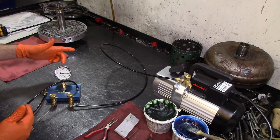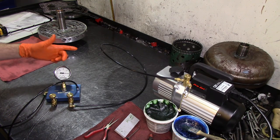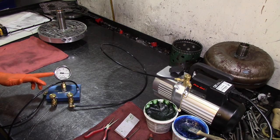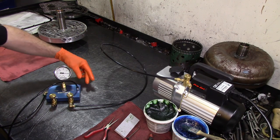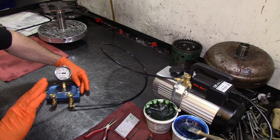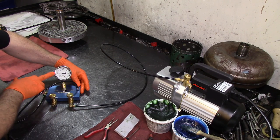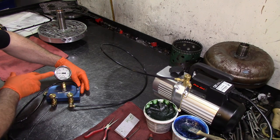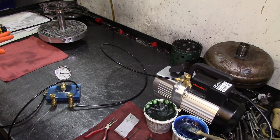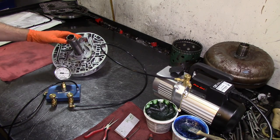We want to be in this calibration range. This 30 thousandths orifice mimics 30 thousandths of an inch of valve bore wear. A good valve bore will typically read above 15 inches of vacuum. At 25, that would be perfect vacuum — meaning no leaks at all. On some boards you'll see close to 25, and on some, exactly 25.